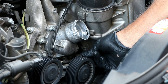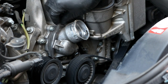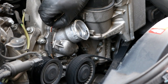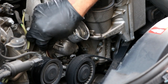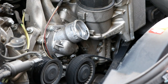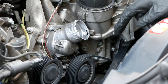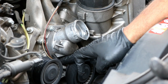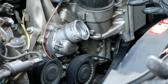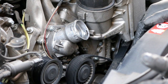It is going to be very brittle because of all the heat in here. I got this one off and it wasn't a big deal, but you can see this harness is crumbling to pieces. Do your best to get this connector out. The easier way would be to cut the zip tie, take the housing off, flip it upside down, and then take the connector off. However you want to go about it is fine.